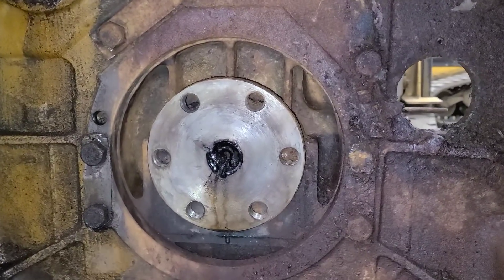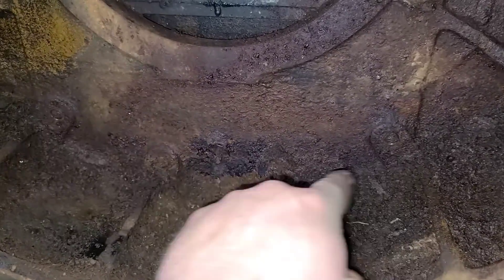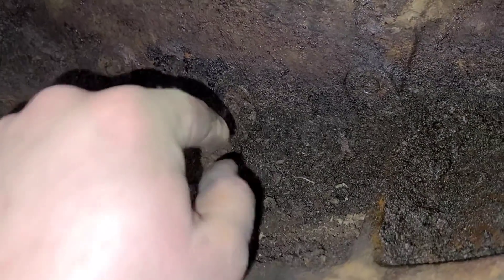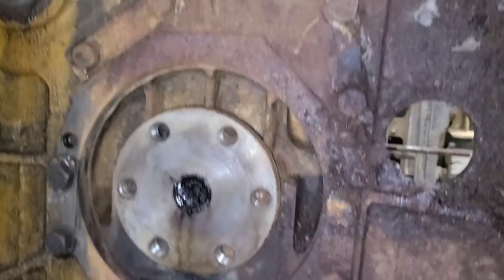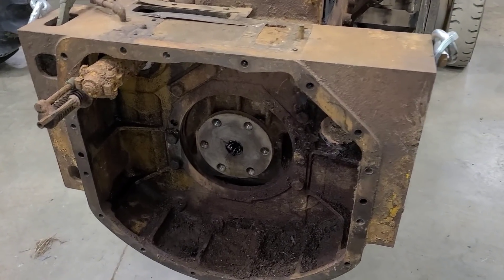With all the fold-over locks taken care of, if you look down here there are four bolts that come from the oil pan into this bell housing. I already went and made sure those will come out — I was kind of worried, being that they've been sitting in there, the threads would have gotten rusty and not want to back out. But all those are loose, so I'll pull those four out, then take all of those bolts out, and then we should be able to pull this entire flywheel housing out.